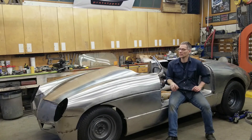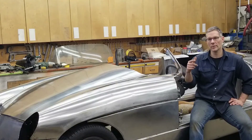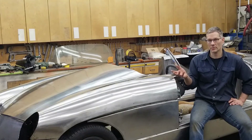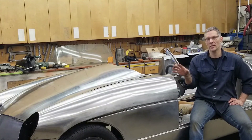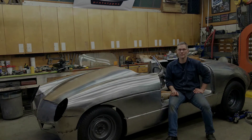I'm really happy as to how everything came out on this build. All the exterior panels lined up exactly where they were before we did all the structural detailing — all the screws, all the marks lined up perfectly. Now we can cut the tacks, take the screws out, and take all the panels back off the car. I didn't think anything would move, but you can never tell until you do this test fit, and I'd sooner do it now than later. The car can now go over to primer, and in the meantime I can work on the front and rear fascias, get those welded up and finished, so that when the car comes back we can do the final assembly — no going back and test fitting panels at that point, we'll be in the home stretch. Thanks a lot for watching, give us a thumbs up, and see you in the next episode — take care!